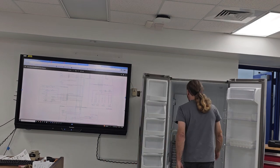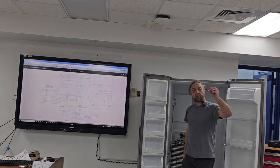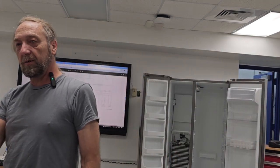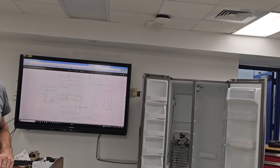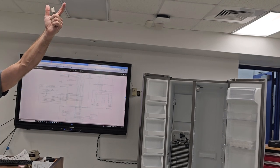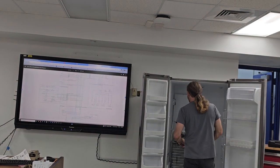Our defrost thermistor is located right here — just like the other thermistor, it's a little tiny wire with a little sensor on the end, with a clip holding it in place. This is the thermistor on the evaporator telling the defrost control how warm it is back there and to turn the defrost heater off so we don't overheat it — same function as a defrost thermostat or defrost bi-metal. That other Samsung refrigerator had eight or nine thermistors controlling defrost on both evaporators because they don't defrost at the same time, with variable speed fans. This unit doesn't have all that — this is a basic, simplified refrigerator.